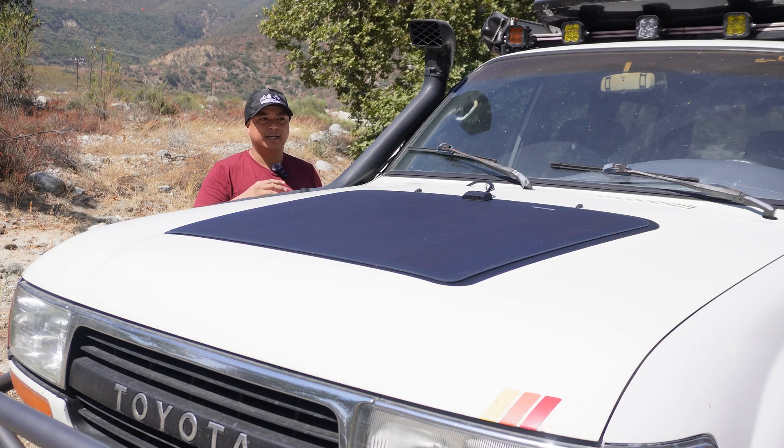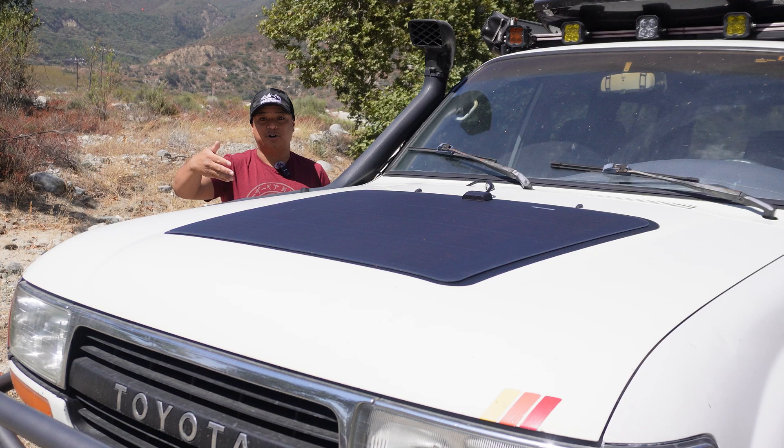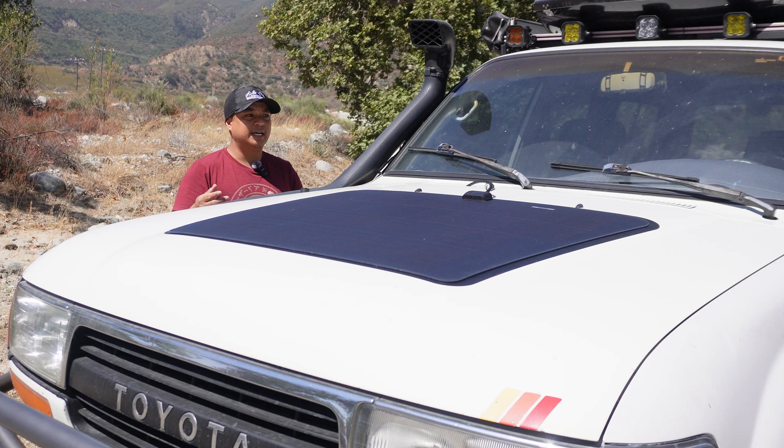Before, I was only getting maybe about 90%, but now I'm able to get the full 100%, and that's with the help of the solar panel. So while the car is off, it's charging right now back to 100%. The cool thing is with the panel — once the battery is at 100%, the controller cuts flow from the panel.